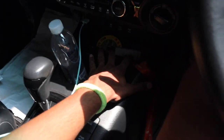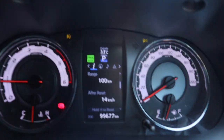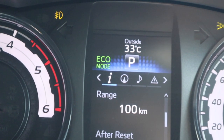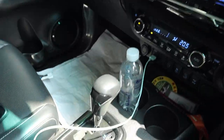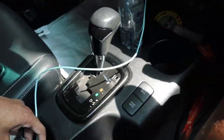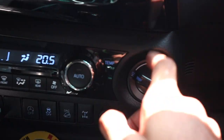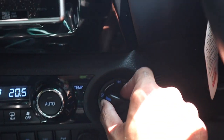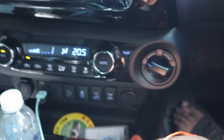There's some storage down here and two cupholders. For drive modes, you can click power mode or eco mode — power mode is sort of like sport mode, though you'll never be carving canyons in this thing. You also have a full 100-watt outlet. Over here you have your four-wheel drive control: right now you're on two-high, twist it and you're on four-high, then push and twist again for four-low. Just make sure you're in neutral if you want to go to four-low.